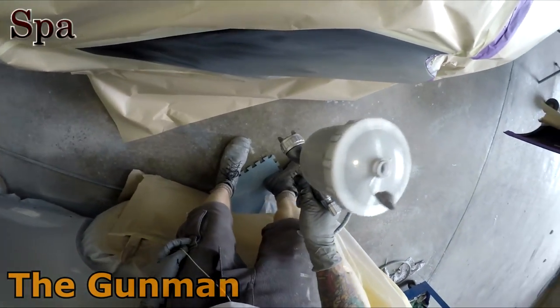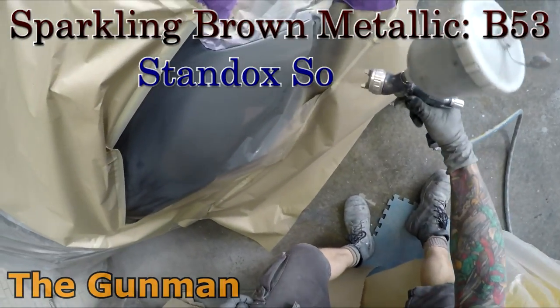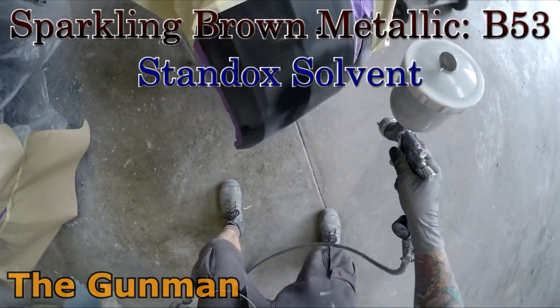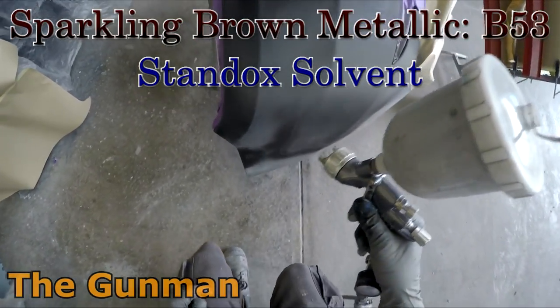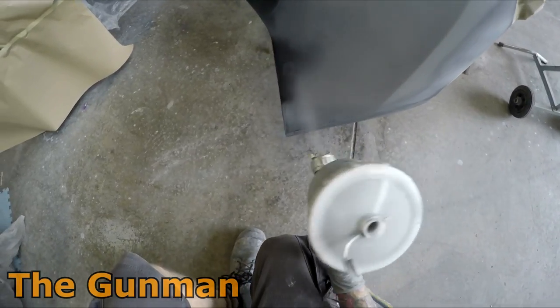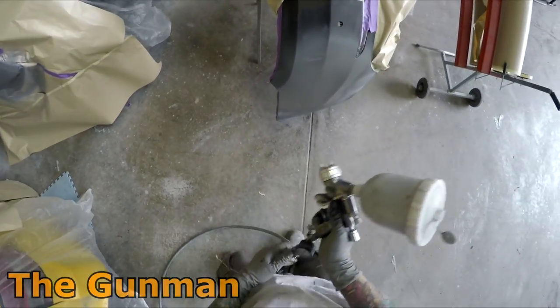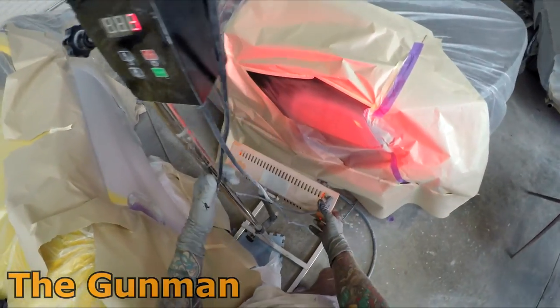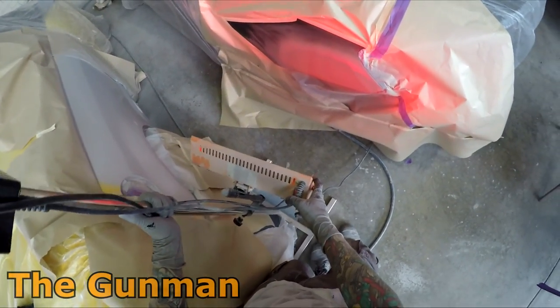The colour code is B53 and the name of the colour is Sparkling Brown Metallic. As you can see, first up it rolled in from the panel shop with a couple of repairs on it. I've obviously feathered that out, scotch brighted all the edges, then masked it up and we're getting a couple of coats of primer on. But first up I did put some plastic primer over the bare plastic parts on the rear bumper bar and a little bit of etch primer on the bare steel on that quarter panel.